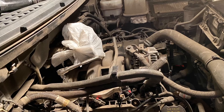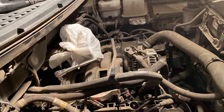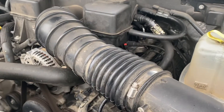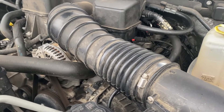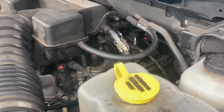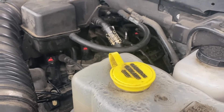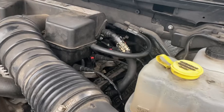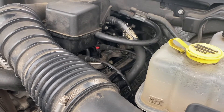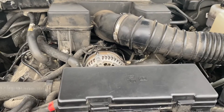After the plugs I moved on to the next possible cause. I had a check engine light indicating the number eight cylinder wasn't firing, so I was pretty sure I knew what it was, but I also thought maybe it was a coil pack — much easier to replace than a valve spring. I got a new coil pack, but the number eight cylinder still had the same issue and the truck was still running really rough.